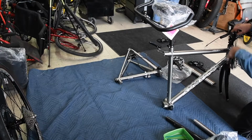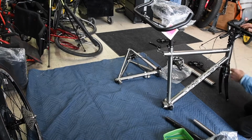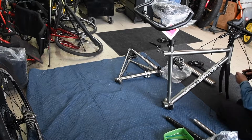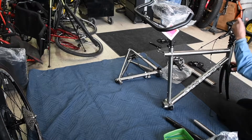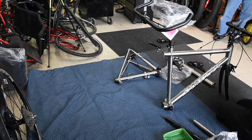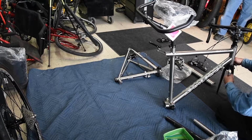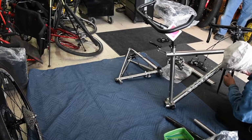Now, I have my captain bars on, stoker bars on. These are going to be my kickstand. While I'm at it, I may as well, since I have the same tool, install my front caliper, okay? 5mm recess nut, preload it onto your tool, poke it in the back. Remember, this is a fresh assembly right out of the box, first time. After you've done this a while, things will go together much better.